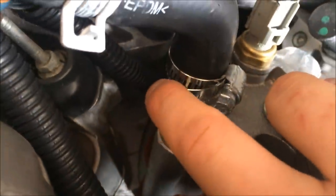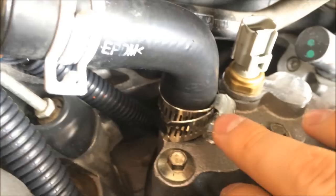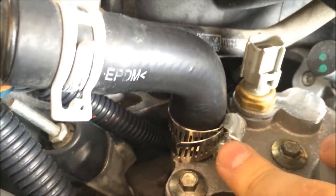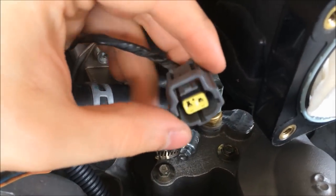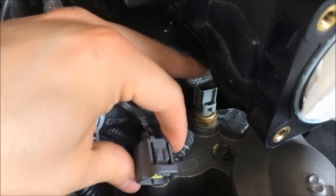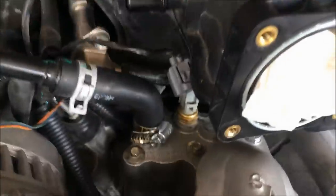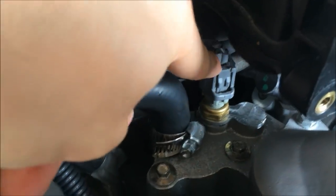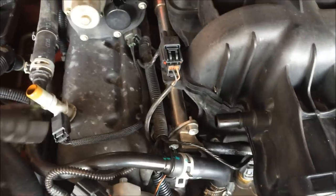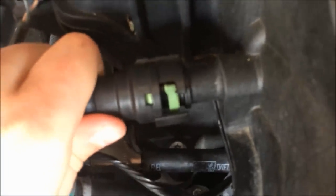However, you don't want these too loose because that can cause a leak too. Tighten them up pretty tight. You can see in between these grooves — if you're tightening too much, you'll see that rubber start to come out where it's cutting it. If you see that, just stop. Now if you have any trouble, if you have any coolant or water that got in there, you can spray some WD-40 in there on both ends, let it dissipate a little bit, and connect it back. If you don't want to use WD-40, you can get some electric cleaner, spray that in there, and let it dry. Go ahead and connect this temperature sensor back up — it just pops right on top and snaps in.